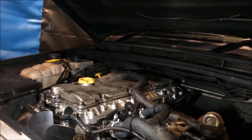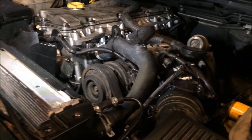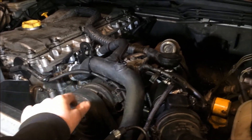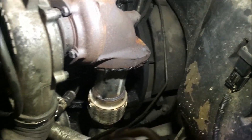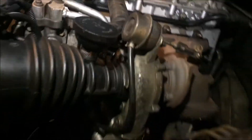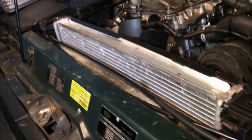So that's where we are now. Pain in the arse it is. This thing has had an EGR delete on it — it's got an EGR delete kit, it's either a stage one or stage two remap on it by Storm Tuning. It's got a stainless steel three-inch system on it all the way back. It's just gasket goo on the exhaust manifolds — something I picked up from motorsport. Using gasket goo or silicone really, really saves leaks better than exhaust paste, just so you're aware.